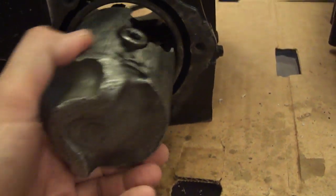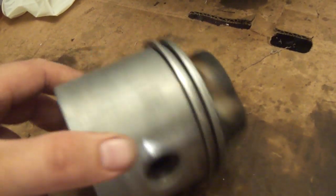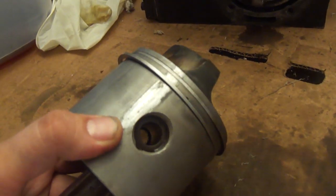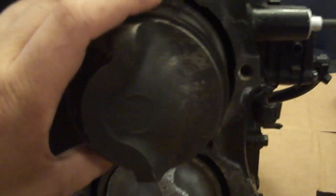As for the pistons, we do have a little bit of a rub mark on this piston here, but it's perfectly round. I'm assuming that's from some of the missing metal - maybe a thin layer worn onto here - but the rings and everything look fine. Other than that one wear mark, and I can see one by my pointer and one by my thumb, it's still perfectly round and the cylinder is fine.